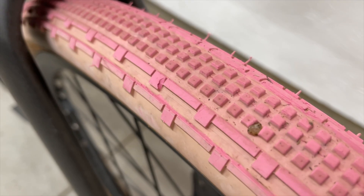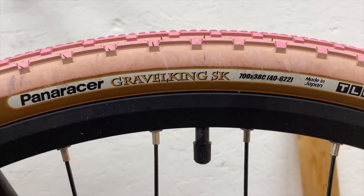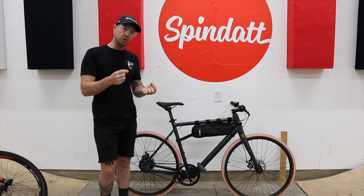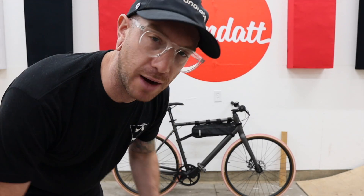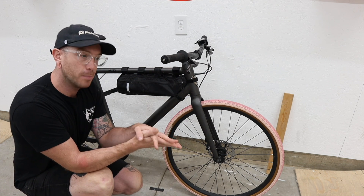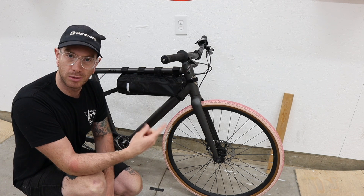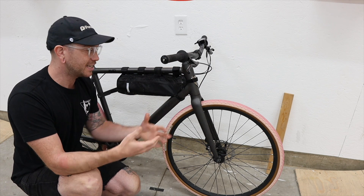The more you like the way something rides, the more you'll ride. Finally, tires. Most stock tires have a really stiff, harsh sidewall — they last a little longer but don't feel great and don't offer a world of grip. The Panaracer Gravel Kings I have on this have a folding bead so they're lighter, a much more supple sidewall so they're more comfortable, and the compound itself offers more grip. If you take a new set and ride a gravel path, it'll be flicking rocks everywhere because it's so sticky.